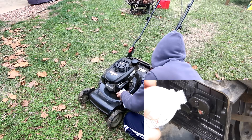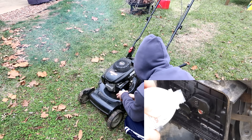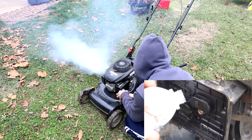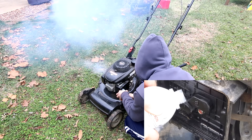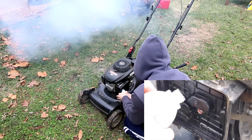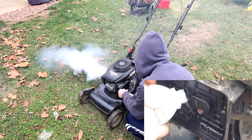I'm adding the seafoam slowly — enough so that a bunch gets in there, but not too much so that the engine stalls. You want the engine to stall at the end, but not right now. Right now, you're using a third of the can of seafoam, just like it says in the instructions. And once you're done with that third, you'll pour just enough so that it stalls out the engine. When you're stalling out the engine, you don't want to pour too much either — you don't want to hydro-lock the engine, especially for one of these small engines. It'll be pretty easy to do.